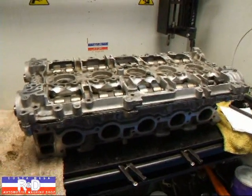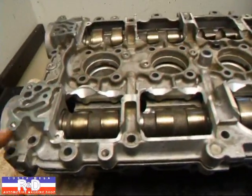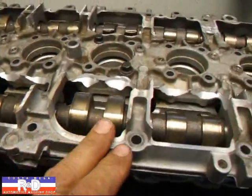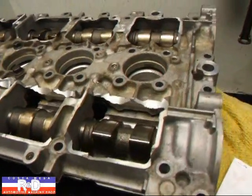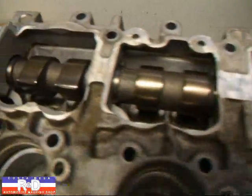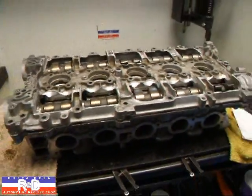Hi, it's John and Coach from Mesa R&D. Today we have a five-cylinder Volvo head on the stand here, and as you can see we've taken an old valve cover and cut the thing open so that we can get in here and actually adjust the valves. Volvo has a special tool for doing this that's very expensive, but if you can find an old valve cover and mill it out you can make your own.